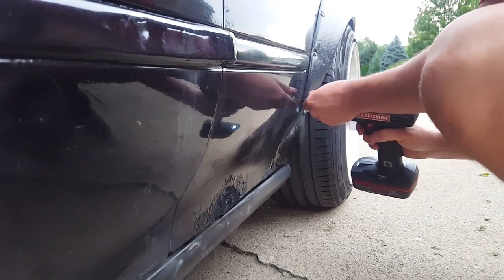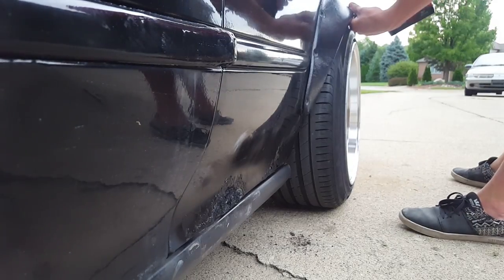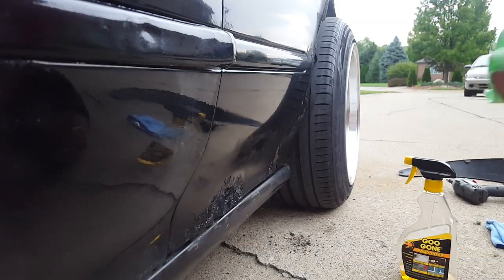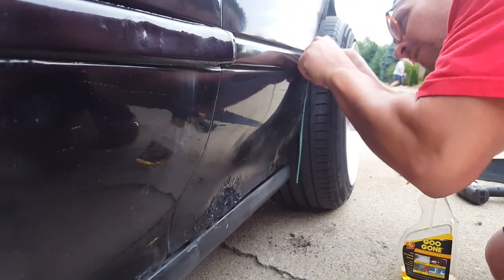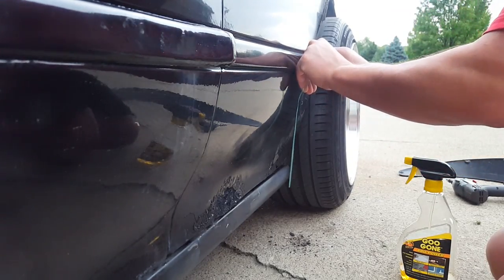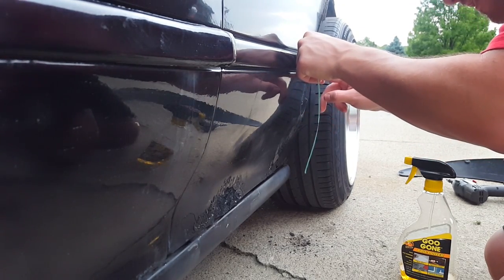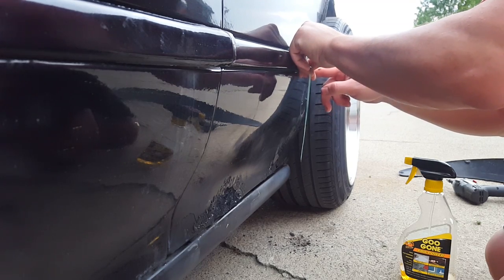Now I'm going to start wrapping the rear quarters. Once again, don't forget to clean your surface. What I'm using here is called knifeless tape. I'm using this because the body trim there on the side stopped before it gets to the back wheel. I wanted to create a nice clean line along where that trim is. I use knifeless tape so it cuts the vinyl from the underside so you don't have to use a knife against your painted surface.